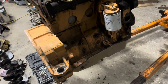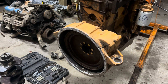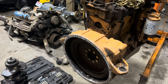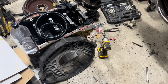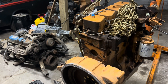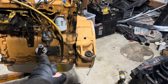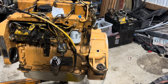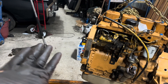After a little running around and visits to two parts stores, I've got an oil pan installed and this bell housing adapter — an SAE adapter that was used in the piece of equipment this engine came out of. I could bolt an Allison or something right onto this. What I want to do long term is use this Chrysler block adapter, which is shorter and bolts to the Chrysler transmission. My genius plan is to use a Chrysler automatic behind this engine if I can find one. One issue: the Chrysler block adapter locates the starter here, and this oil fill mounted to the block where one of the mount plates goes won't fly with that huge old starter. So I'll have to change that arrangement and get a cap up here somehow, or just put the filler on the timing cover like truck engines have.